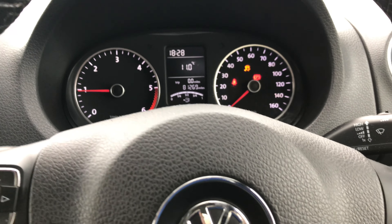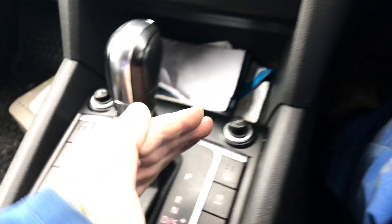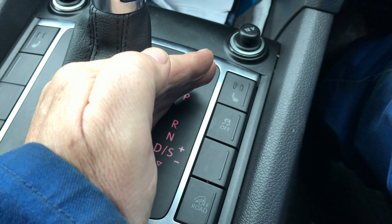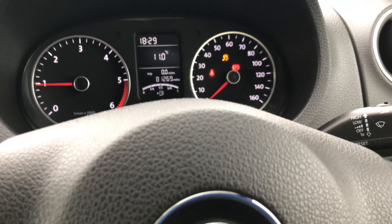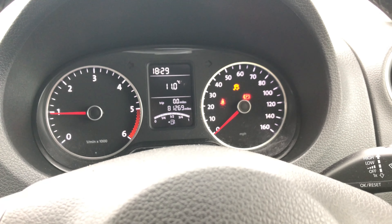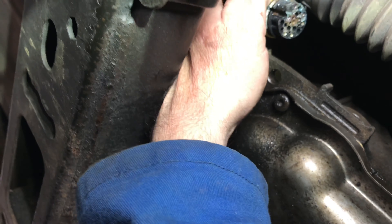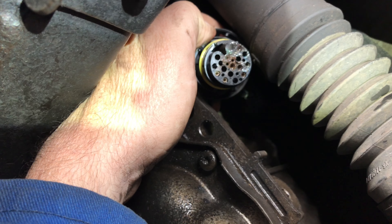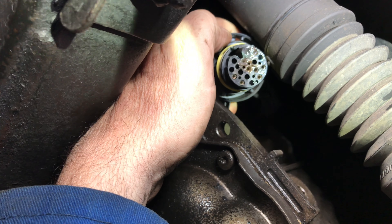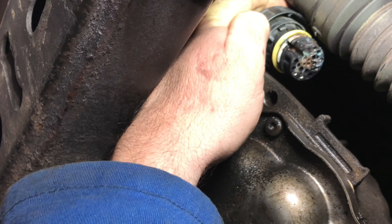But what I did do - I went underneath the car to where the automatic gearbox is. There's a big multi plug and I wiggled it. Now you can see - with me wiggling it, the fan is on up the front and I've no longer got that flashing green light. These lights are illuminated, but you've got to wait until you get that green thing on the dash. So I'm going to go back underneath and wiggle that plug again - see if it comes back, or take it off, put it back on. Maybe there's oil in it or a bad earth - that's what I'm going for anyway. This is a difficult shot - no wonder we're having problems, look at the state of that multi plug. It's absolutely soaking. So where's the mess coming from - internal, leaking out of the box, or something getting in past that seal? The seal looks pretty good.